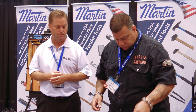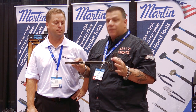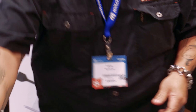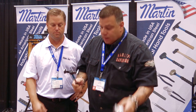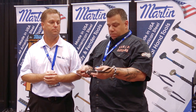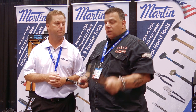Something new we've talked about on Collision Hub Repair: when you have a dent in a fender, the first thing you want to do is try paintless dent repair type techniques. They have a variety of PDR rods — shorter and longer ones — to get into areas and push some damage out prior to hammer-off-dolly techniques. If you're going to buy a set, buy two sets if you want to do both steel and aluminum. Paint the aluminum ones red at the bottom or wrap them with tape, or use the plastic blue-handled versions for aluminum and keep the wood ones for steel. Leave them in dedicated areas.